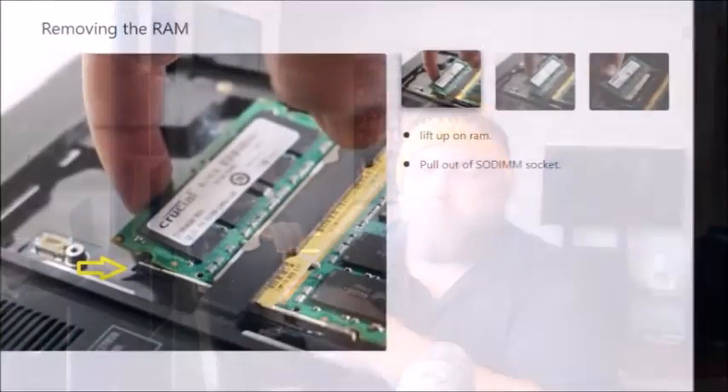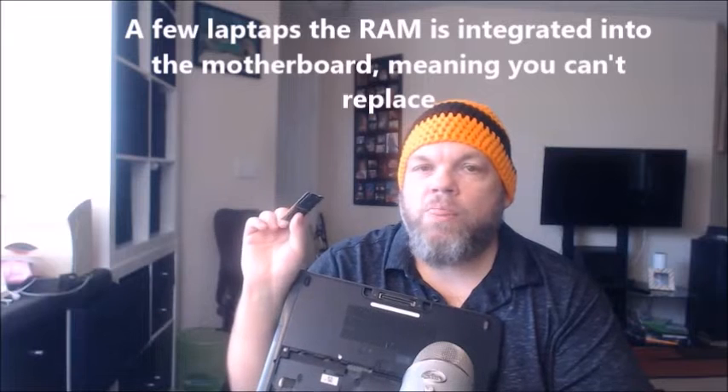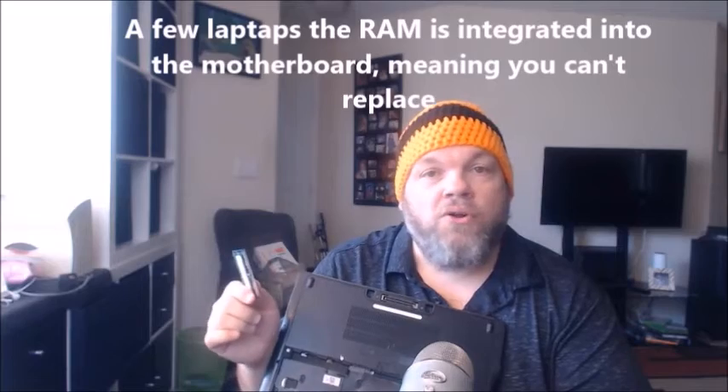Check the memory — the slang term is RAM. This particular one is DDR3, but most newer laptops use DDR4, where the slot is a little closer to the center. Take your battery out again; on this Dell the memory is underneath the base panel, which you'd need to unscrew. There are YouTube tutorials on where to find the RAM. Most are easy with small compartments. Laptops usually have two RAM chips side by side — they just click out when you press the two little metal tabs.